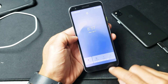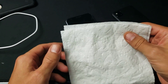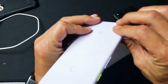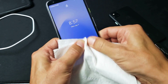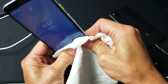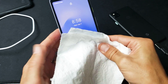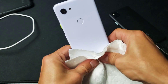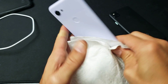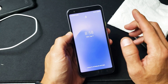If you're still down, the next thing is what I call the massage method — we're going to massage the phone. Grab a paper towel if you don't want to smudge the screen. Press and hold both sides of the phone with your thumbs and press in, giving it a nice massage. Keep watching the screen — it may get out of the boot loop. Do this all over both sides, near the lens and fingerprint sensor. Then press and hold the power button until you see the Google logo.